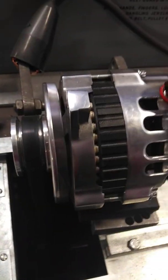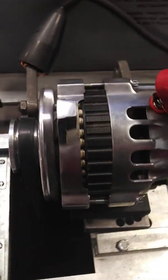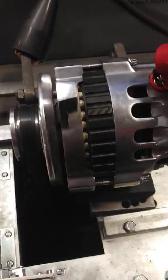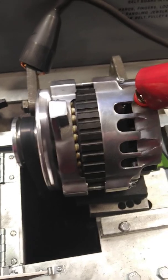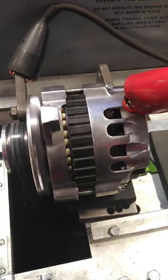The difference between theirs and ours is ours has dual internal fans. You won't have the external fan, but cosmetically it looks exactly the same — direct fitment. This one here is rated at 180 amps peak at 1,800–2,000 RPM. But the main thing we want to focus on is the idle output, because that's where most units actually drop off in terms of voltage. So we want to go ahead and show you a side-by-side comparison against our unit.